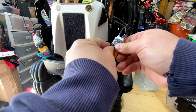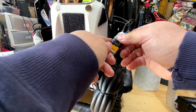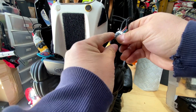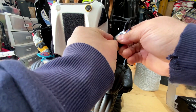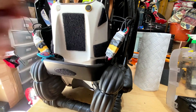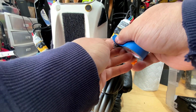Once it's in, press in - and that really seals the plug. You can see that it's very sticky and soft. That is 100% waterproof - this plug. Cover that up, I'll use some insulation tape.